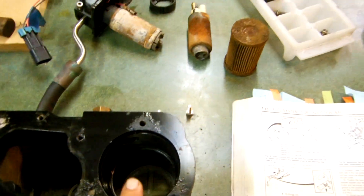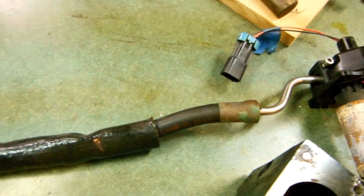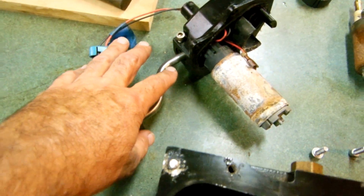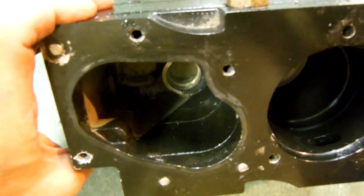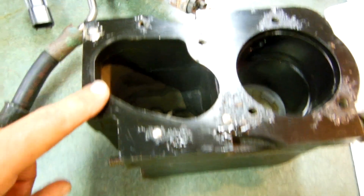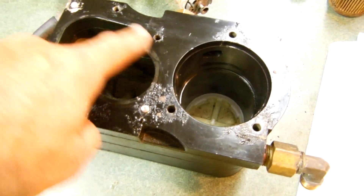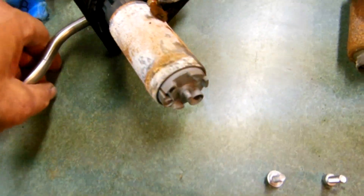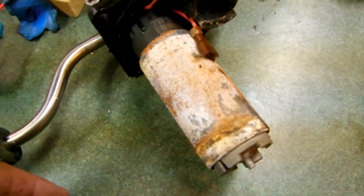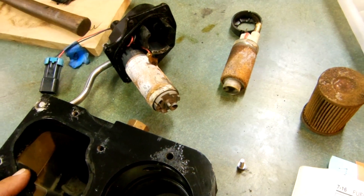So of course I had a look at what's after this filter, which is the fuel pumps. They go into this top piece and into this pipe which goes up to the fuel rail and the fuel injectors. In a couple of videos I saw there was concern about paint coming off inside here. Fortunately I don't have that problem, but there was also discussion about breaking these bolts off on top — and as you can see, we had the same problem. The pumps are fully rusted due to the water coming through the system, basically just because of no maintenance.